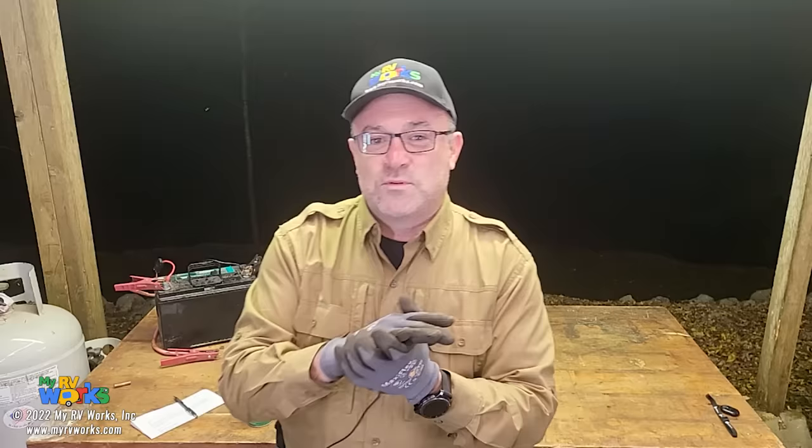So for all of you guys that have this problem of going out 2 inches and stopping, going out in 2 inches, it's not really faulting the motor. It's just saying, okay, I guess I'm amped out. And amping a motor out is not a fault. So maybe that's why it's working so hard. It's burning too hard, might get up like 12 or 13 amps when 5 or 6 is where it needs to be, and it just stops. It's like, okay, I guess I'm where I need to be.